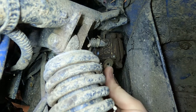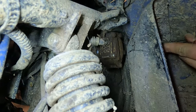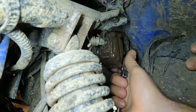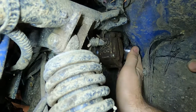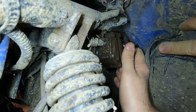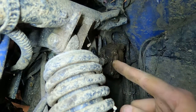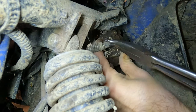It looks like there's a steel washer on each side of the rubber insert in the frame. Hey, that makes a lot more room! If you pull one bolt out of the top — it has a Phillips head screw on the outside of the plastic — this top piece of plastic comes right out, which is awesome. Now there's not a whole lot of extra room, but we're going to pull these lines off. The trick with fuel lines is to get them to spin first before you try to pull them off.